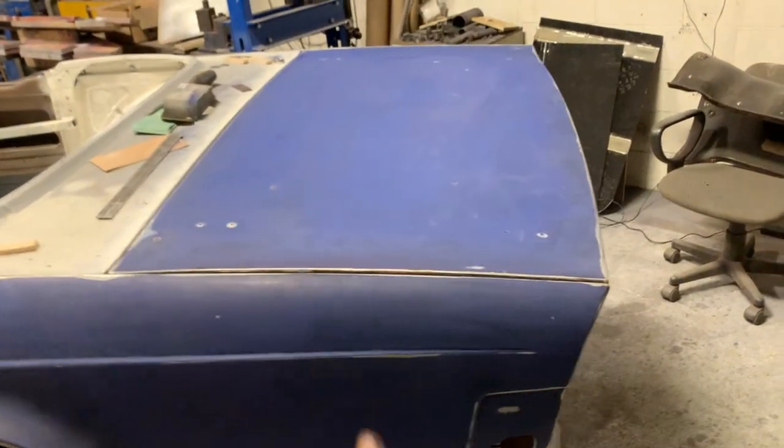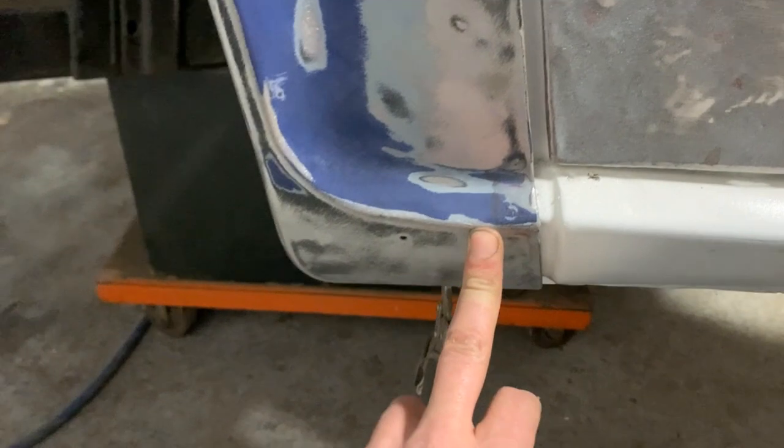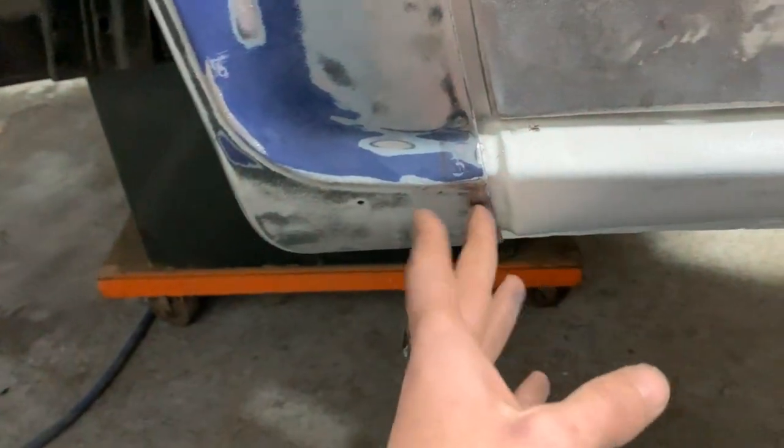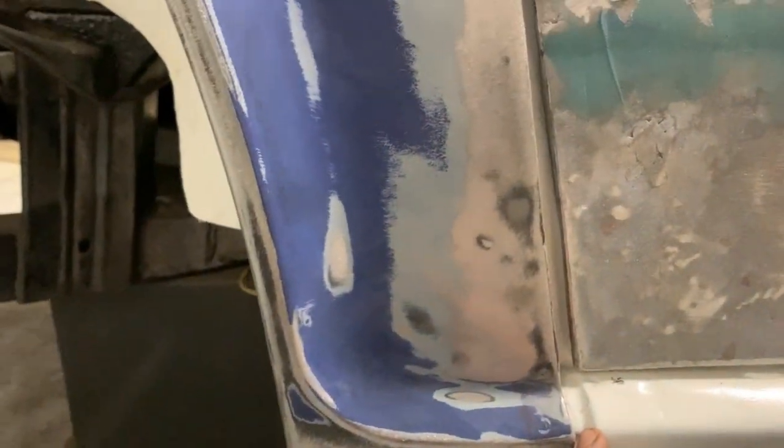With the bootlid sorted, I think it's time to turn our attention to this gap here — that's the biggest problem we have right now. This fender needs to come forward. Last time we fitted it, this was closing properly here and the gap was good on the door. What changed since then is I installed the back of the B-post, this piece here which is now pushing it out. Unfortunately there's nothing else to do other than cutting this mount off the fender and welding it in a different location. We need like a quarter inch only at the bottom end, so we're gonna cut it somewhere in the middle and move it.